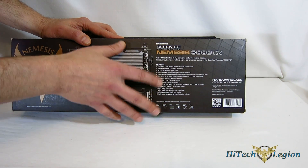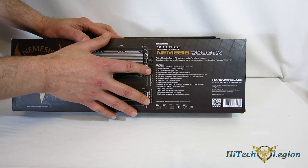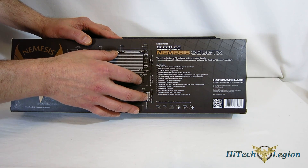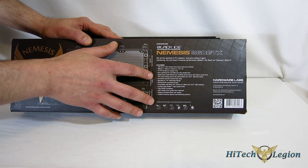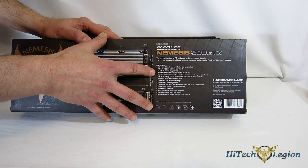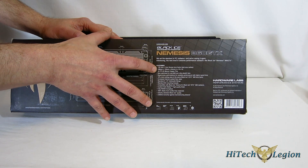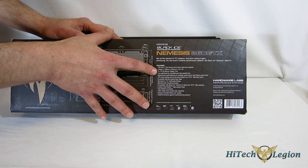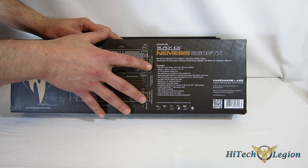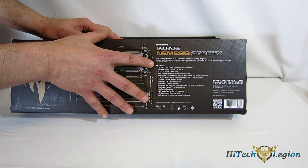Taking a look at the features: 120mm by 3, extreme form factor — so a 360mm radiator. It's 54mm thick and 133mm wide. It has 16 FPI with 25 micron copper fins. So it's fairly dense, but on the lower FPI scale — not really low like the 13 FPI we've seen before. You're going to get decent performance at lower fan speeds, no doubt, but you'll also be able to scale at higher speeds.